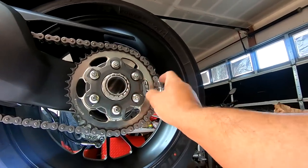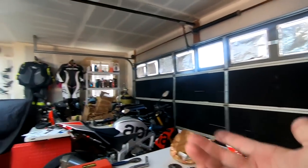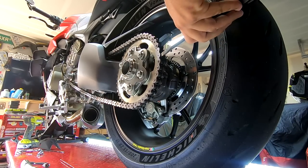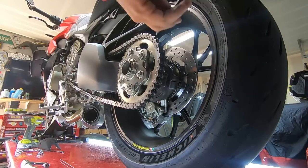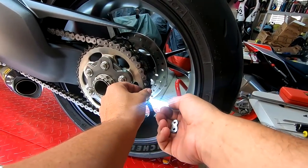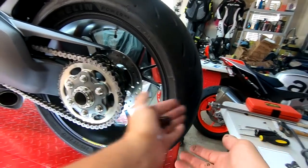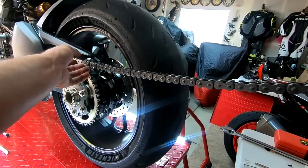You can see I've got it good and ground down. The trick I've learned over the years is don't use the breaker kit — you can actually stick a screwdriver right into the end and tap it off. If you ground it down enough, it should start to work its way out. And presto, we've got the link off. There are a couple of O-rings which we're going to pull off, and we can push the master link through. And voila, the chain is off. So we can go ahead and pull the chain through on the front sprocket.